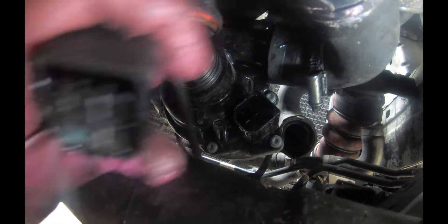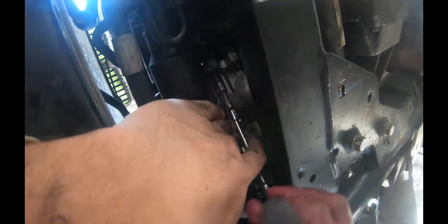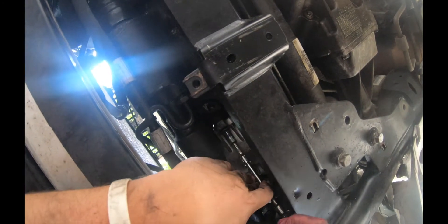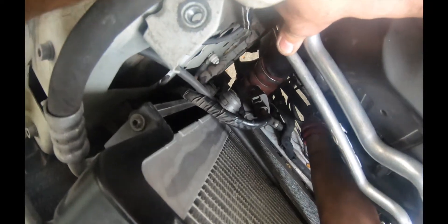This connection may need to be changed because there was water and some oil from the outside. This is the bolt from the upper side — we're gonna try to remove it from the motor side. Using an E10 socket wrench, you are able to connect it to the bolt and remove it. We're removing the bolts from the bottom side first — these are 10 millimeter bolts. Now we're gonna try to remove the pump from the side.